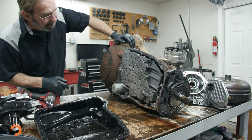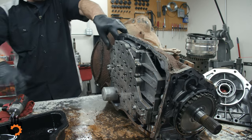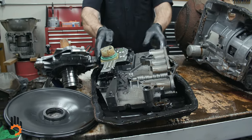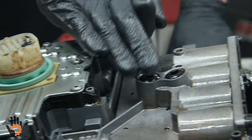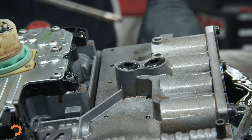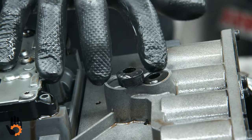We should have them all — might need a little screwdriver behind it — and it pretty much just slips right off of there. The valve body itself has what's known as a solenoid pack or solenoid body that has all the shift solenoids, governor solenoid, everything on it. Be aware of these little three rubber seals whenever servicing the valve body during an overhaul — these seals do get replaced as they collapse a little bit over time. They come in the overhaul kit and help seal the oil passages from the valve body to the case and components inside.